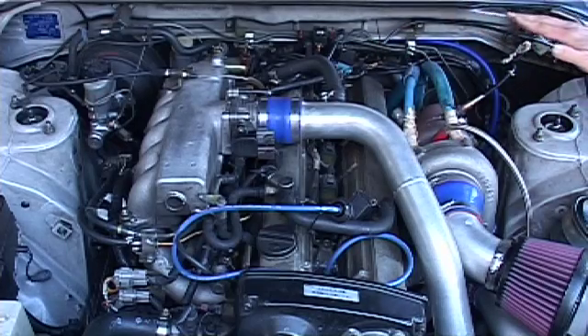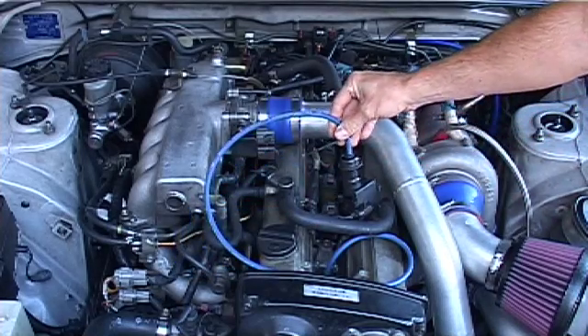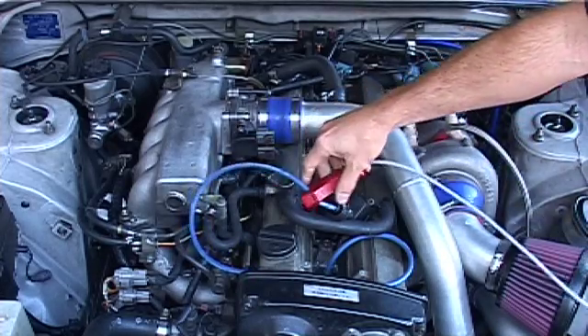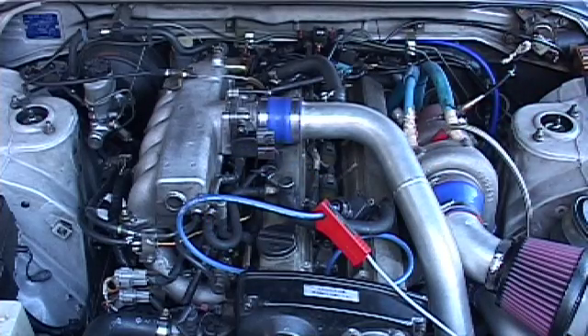This loop is not good for checking the base timing. In vehicles like this that have coil-on-plugs, you must get an old lead and make a connection between the bottom of the coil down to the spark plug, and put the timing light on this lead. Do not use the loop back there because the timing will not be correct.